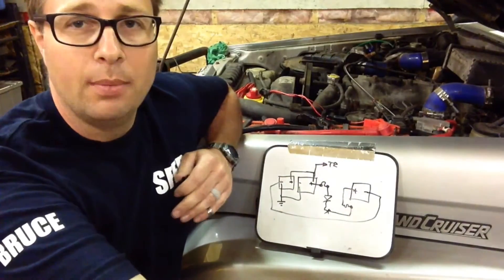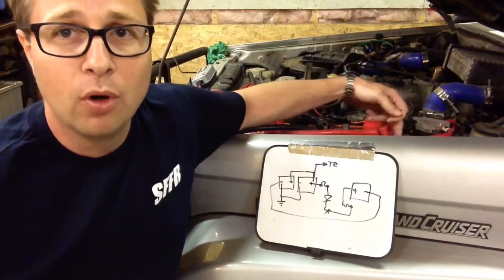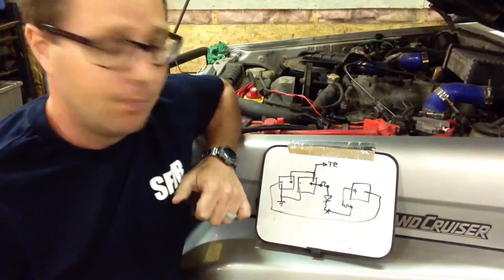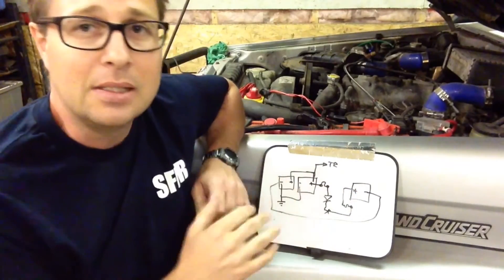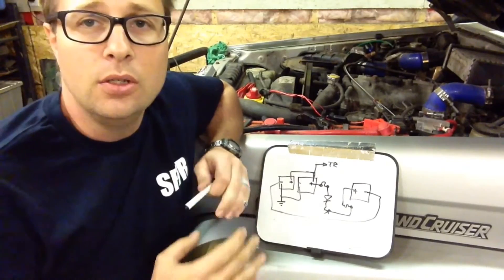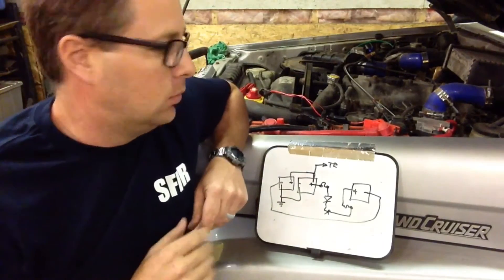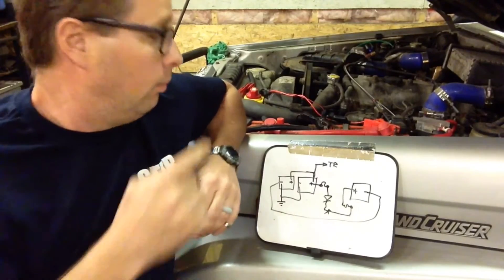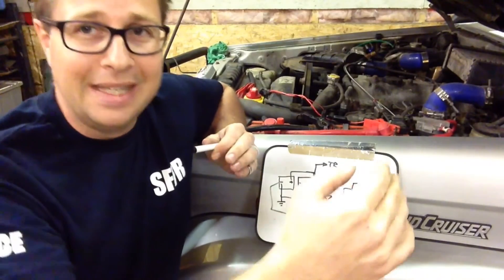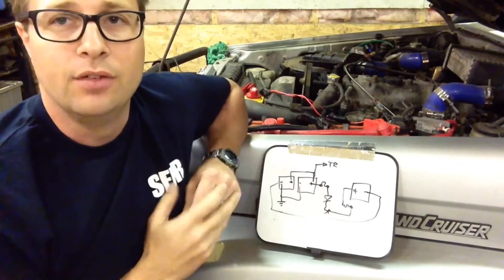If your fuse is 18 inches from the battery, you have 18 inches where you can have a short that's completely unprotected. If the wire before the fuse gets a short in it, there's nothing you can do - it's going to get really hot, melt and make a big mess. So that's why I have two fuses, and in any installation where you have multiple power sources, you want to make sure you have overcurrent protection - a fuse or a breaker - as close as you can to each source of power. That's the key to a proper safe installation, aside from getting all the crimps done properly and good clean connections. I've got 80 amp fuses on each end, so if that cable chafes through in the middle, it'll just pop a fuse on both ends and I've got a dead cable in the truck.